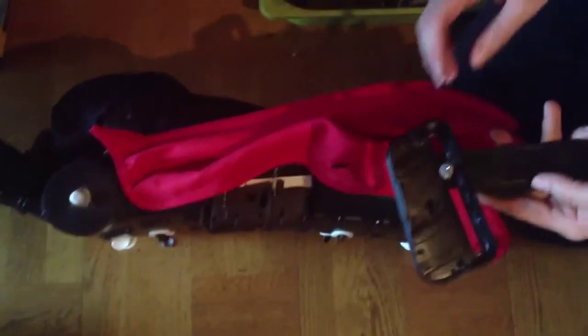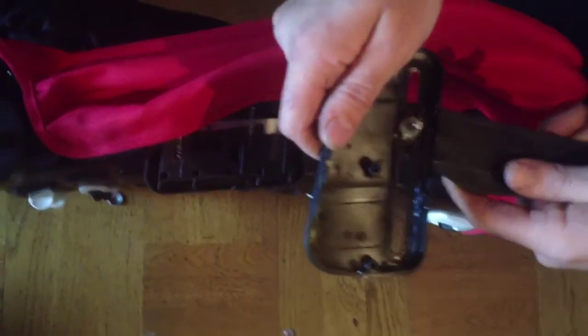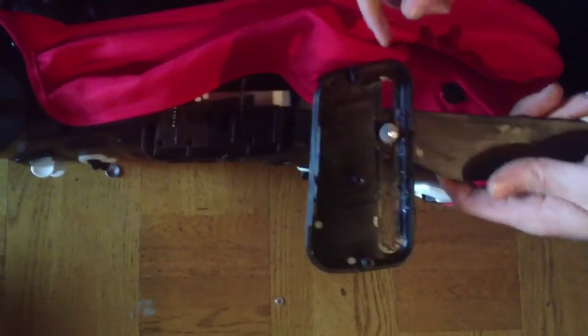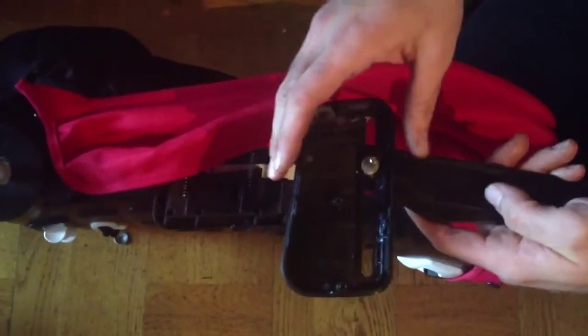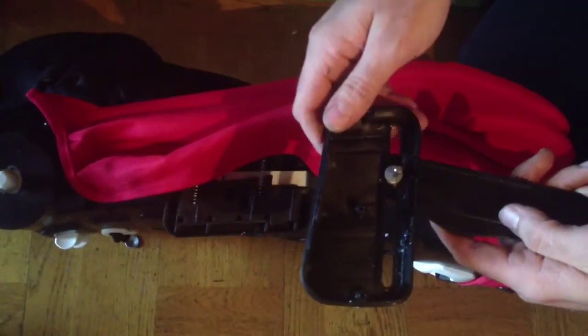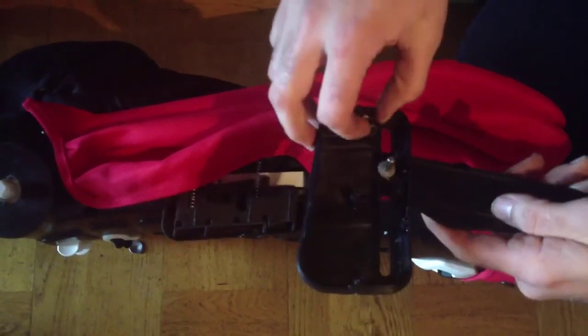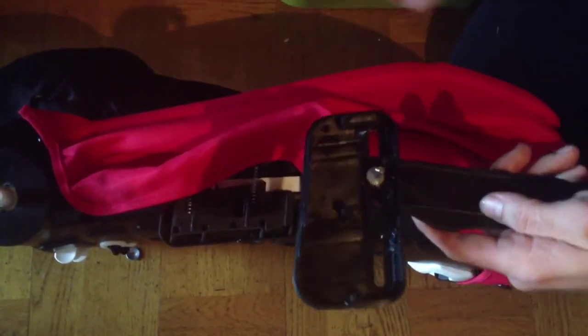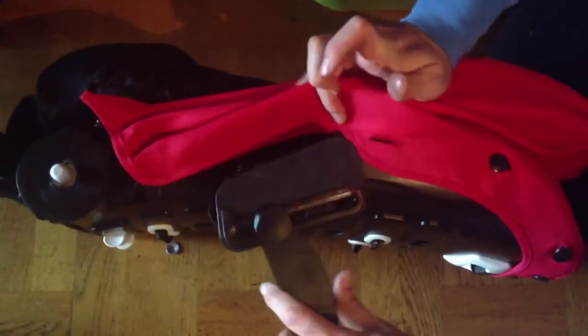Now I have used two metal stoppers with a plastic ring on top and it is pretty solid. I'm not getting a lot of wiggle room side to side, and that's what's important — that the metal stoppers you've used are fit inside the grooves tightly. If there's excess room, then when you tilt it you can bend those teeth and it'll pop right out. I've also greased up the inside track, but I'm going to be careful not to get it on the fabrics.